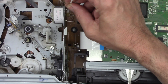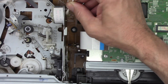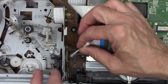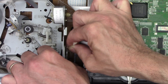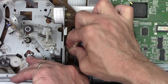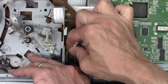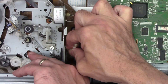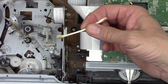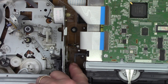To clean the pulley on the loading motor it's really quite easy - you just power the unit up. Got quite a bit off there, not too terribly bad. The other one down here is going to be a little bit harder. Got quite a bit off. We'll get one more cotton swab in here, get the other end moistened up. I'm scrubbing up and down and then I'm going to rotate the pulley very slightly. Just keep scrubbing. Got quite a bit more off there.